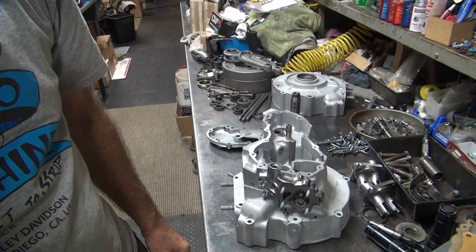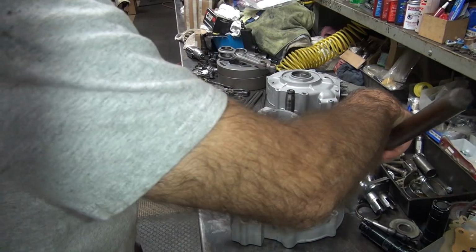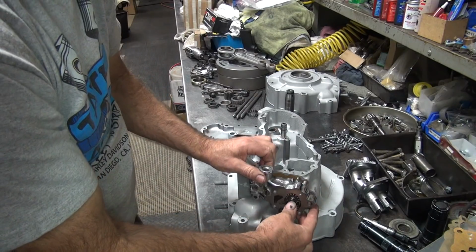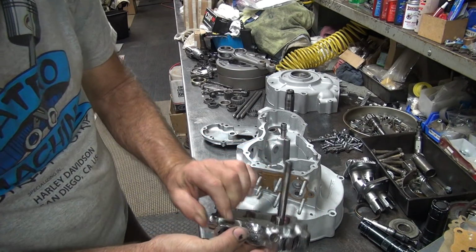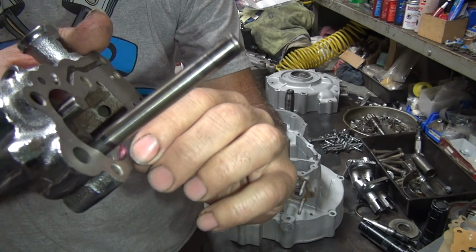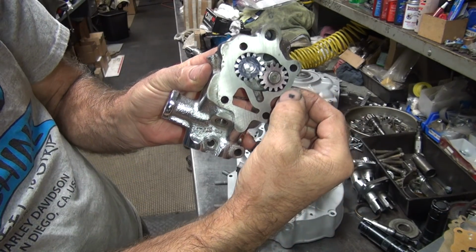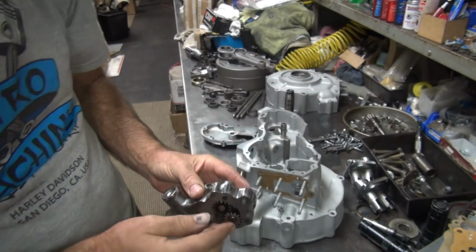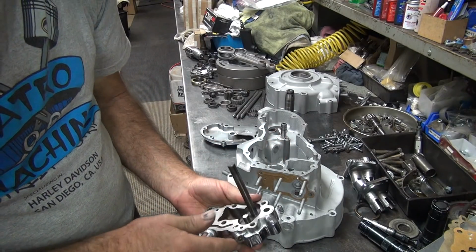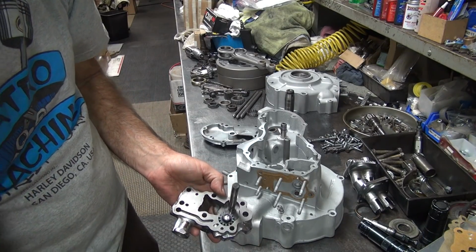Okay, back at it again here. The biggest thing was I ground the inside of the cavity out here. I did one spot on this small gear, and then over here on the big one where it had that big grind mark, I ground in just a little bit there. I think that's where 90% of my drag was. And this gasket is definitely thin too, because they had a brown gasket in this thing. So it's probably a little tight on that also.